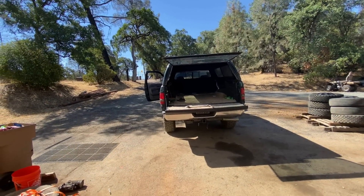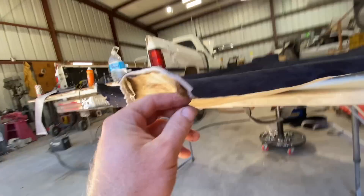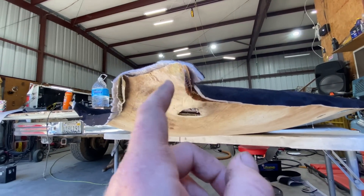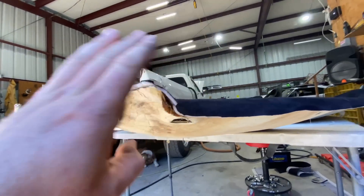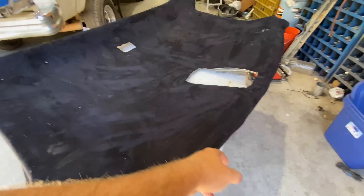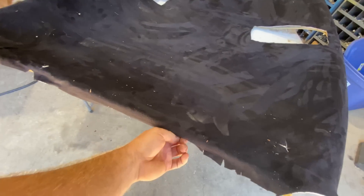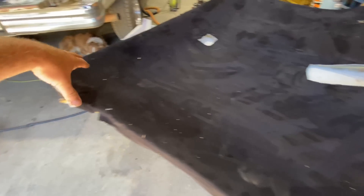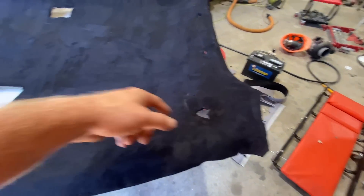Around the corners I had to add a little bit of adhesive towards the sides. The truck is 1994 - so it's a 27-year-old truck. This piece under here is 27 years old and I just pressure washed it - it handled that. There are a couple spots, like right here, where it started to separate, so I put a little spray adhesive inside that and it's holding together. But most of these areas except for the front and back all get covered up - this will get tucked in on the weather stripping. You've got your dome light temperature display, dome light back there, handles, and I just X-patterned these and cut them with my pocket knife. It's super easy.